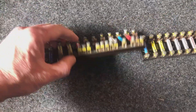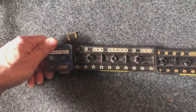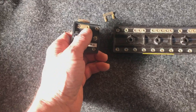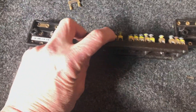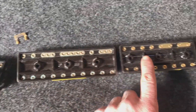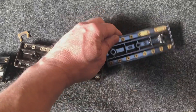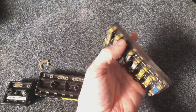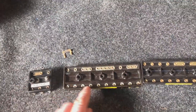On the back of these panels, certain terminals are bussed together. You can see those two are connected together — there's two there, or three. So it's not simply a case that the fuses go straight through. Some are joined, and typically the join is at the top of the circuit, with the bottom feeding individual circuits — lights, wipers, etc.